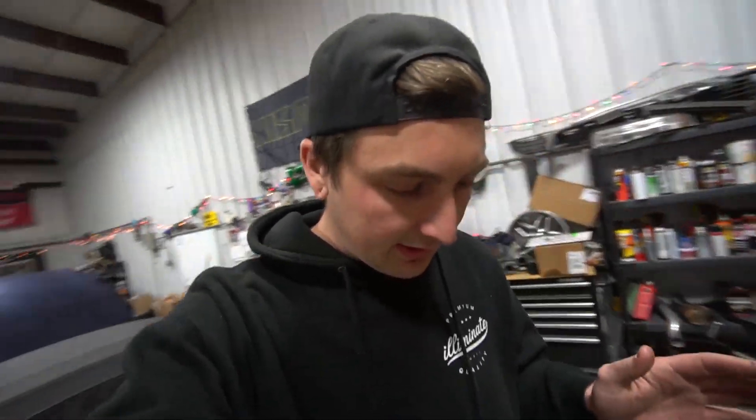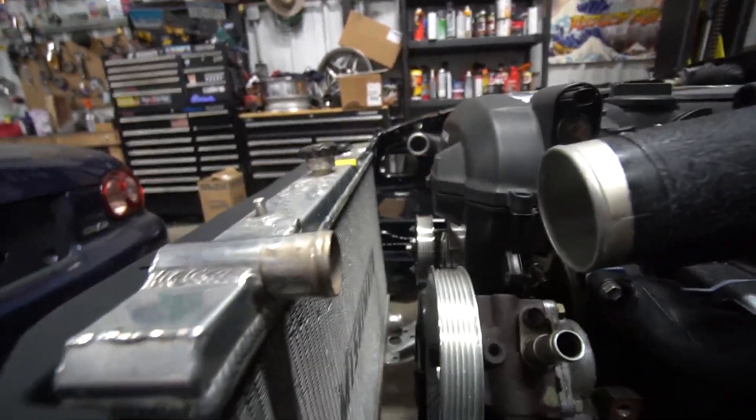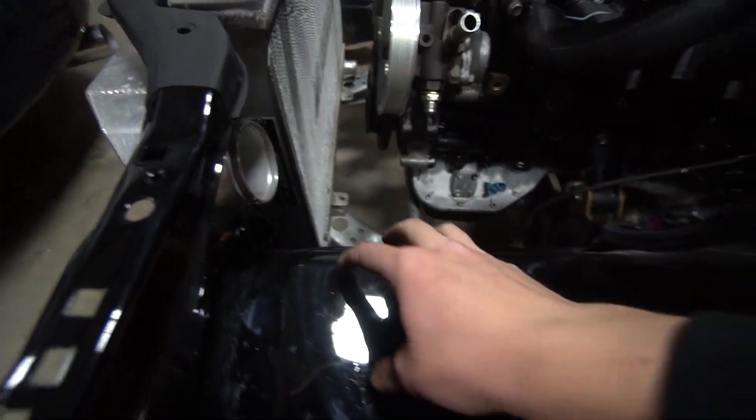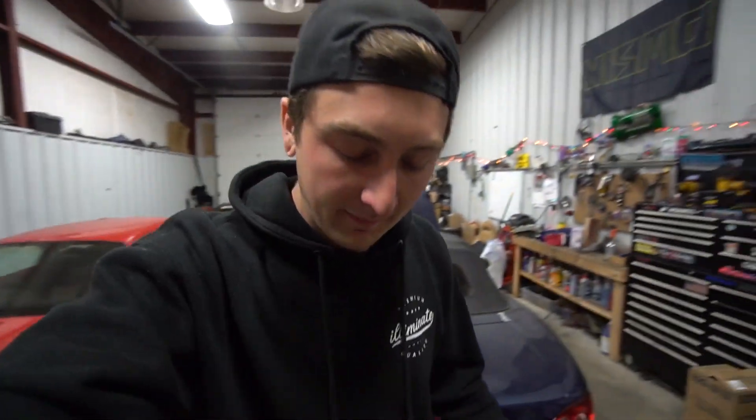All right guys, so I got this throttle body on, and this is a good example of why you always test fit, test fit, test fit. It's on, and as you guys can see, it's not really going to work too well with the mid-mount setup. Most people I see with 1Js and S13s leave it the way it is, but they usually run a front mount. Since we're trying to run a mid-mount, I completely forgot to take into account that everything's way closer, and it would look so freaking stupid to leave it like this. The outlet is all the way over here - you'd usually go down to a front mount, but since we're going mid-mount, we'd have to do a straight 90, and that would just look so stupid.